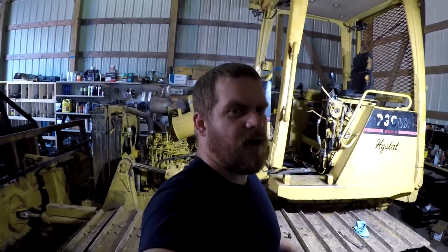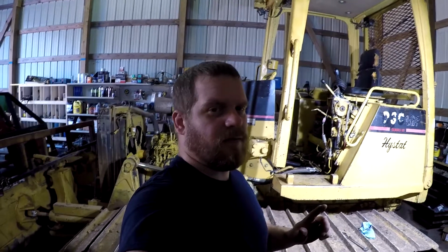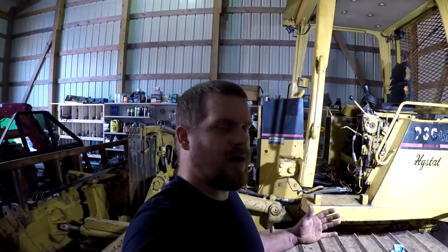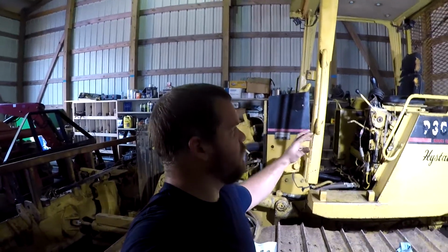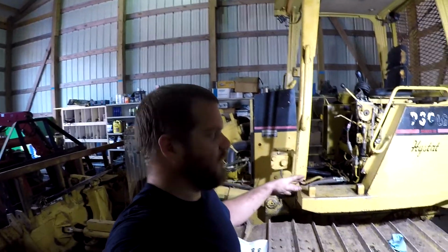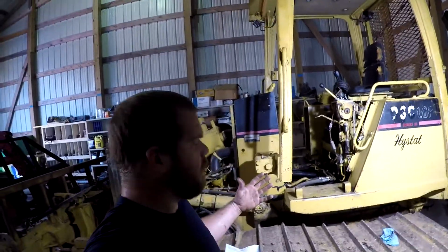So we're out in the shop today, and my goal was to try to remain clean and not be covered in hydraulic fluid. But so far, I'm not covered in hydraulic fluid, but I'm not doing real good at remaining clean either. But anyway, in the last video, we got this thing here where it would at least move under its own power, but the parking brake solenoid will not release, and it still shows a park brake on the dash. I had to basically hot wire the solenoid, apply 12 volts to it from another source to get the brakes to release. The guy told me that everything worked fine, it just quit moving and the park brake light came on. So I don't know what we got going on.